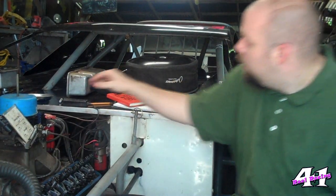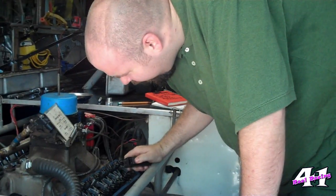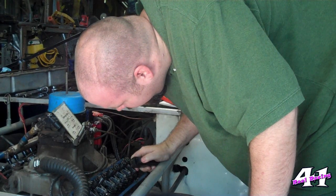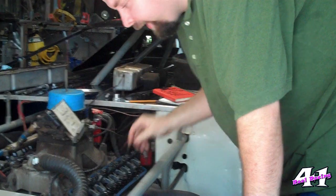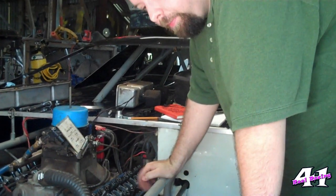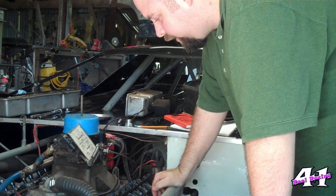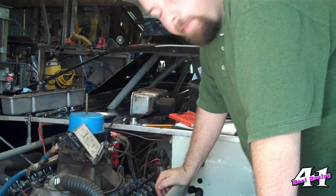Let's go ahead and bump it over to 360. My pointer's back at zero and my number one rockers aren't loose, so I know we're at 360. I'm just going to repeat the same process — use my feeler gauge, do the intake on the intake, the exhaust on the exhaust, check them all, set them all, and then we'll be ready to put the valve covers back on.